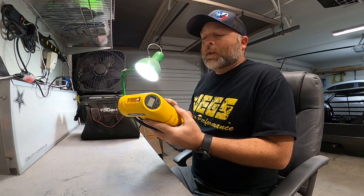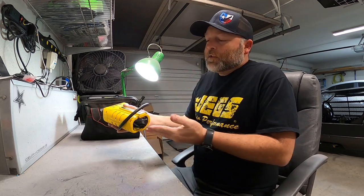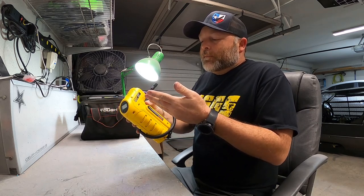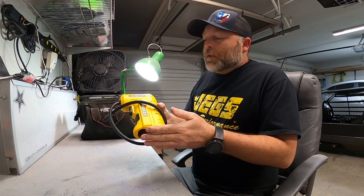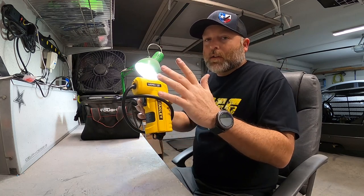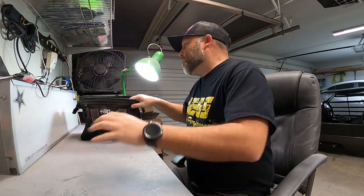First thing that's really important is a tire inflator — this one runs on 12 volts with a cord that tucks into the bottom. It's a Stanley, pretty compact. Super simple digital controls: pop it on the 12-volt, tell it what PSI you want, hook it on, and it shuts off when it reaches that PSI. Super easy 12-volt air compressor.